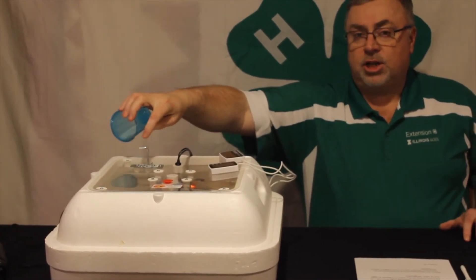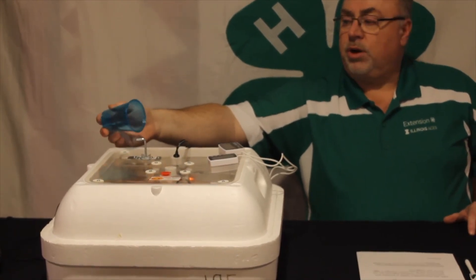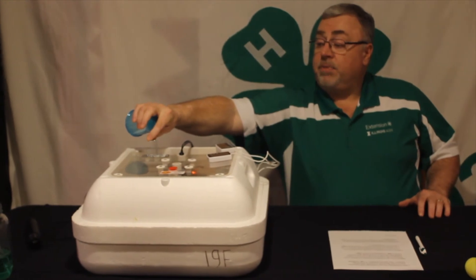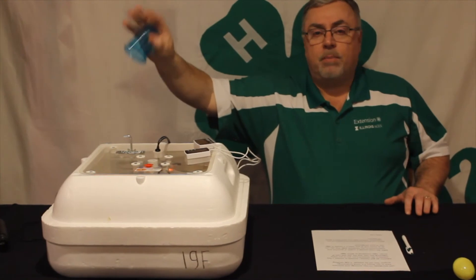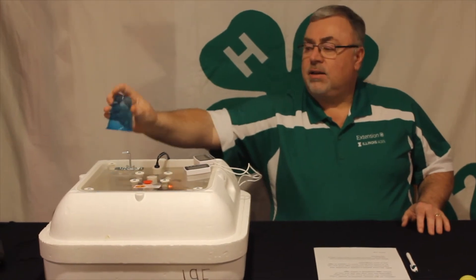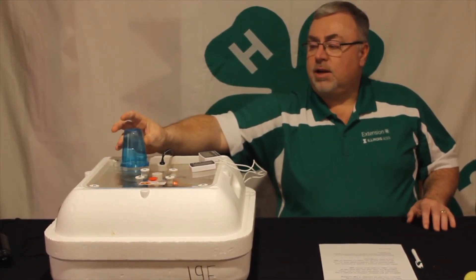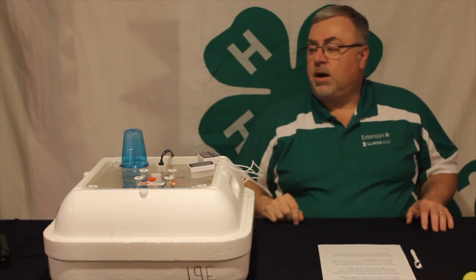This tip is probably more for teachers in a classroom with younger kids: all you have to do is bump that knob an eighth or quarter of an inch and it'll bring the temperature up or down two, three, or four degrees — they're pretty sensitive. Once you get it dialed in, we recommend putting some type of cup over top of that knob, and then taping over it. That way it'll keep little hands from moving that knob, playing with it, or somebody inadvertently bumping into it.